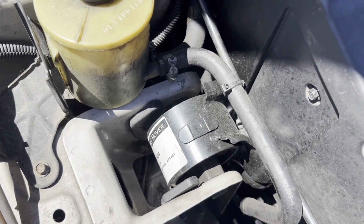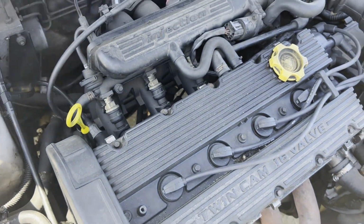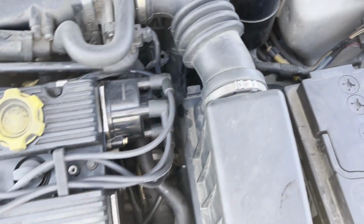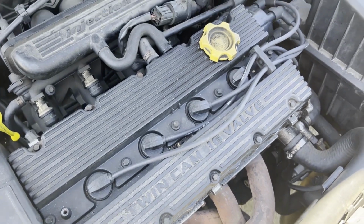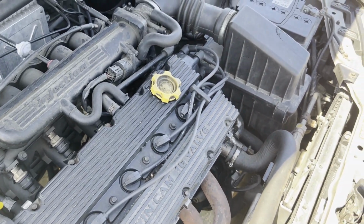You can see there's a new engine mount in here, and the engine mount for the gearbox has also been replaced. I mean, the central engine mount, because this one over here hasn't. It seems to be decent. The clutch has been replaced like 10,000 kilometers ago, and my R65 gearbox was noisy, so I replaced it too with the one for the 1.6.